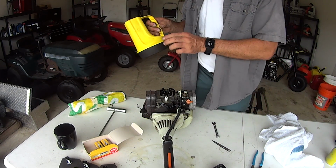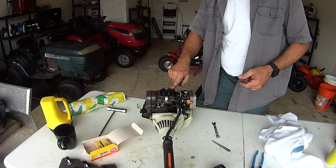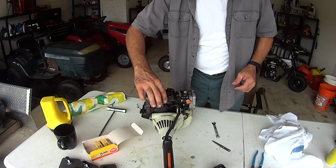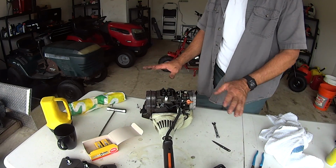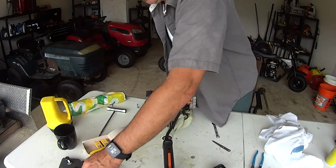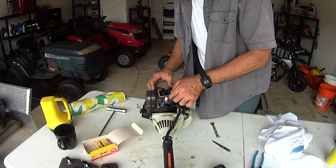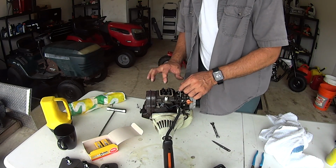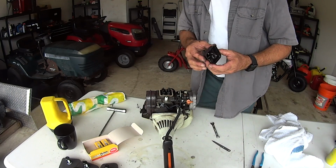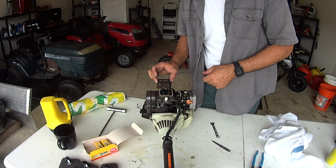Okay, now look things over, make sure everything's all right. No loose parts, didn't leave any tools, no silly stuff. Gasket's good, gasket's cleaned off, it came off in one piece. You can go ahead, set your gasket on there. There is no up or down, just put it on, follow the form. And you got this little notch right here for your spark plug.